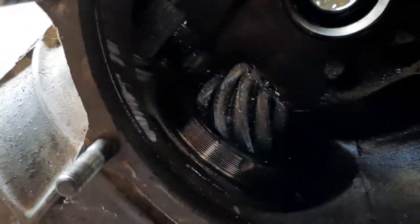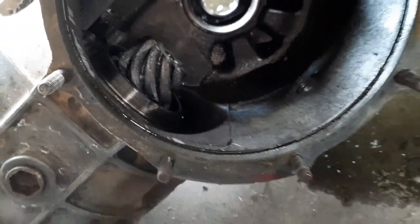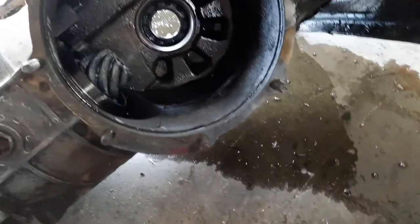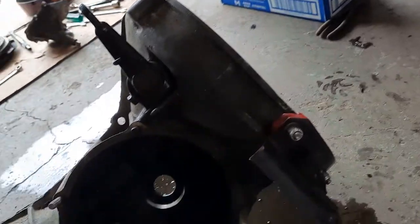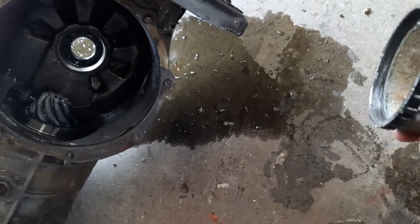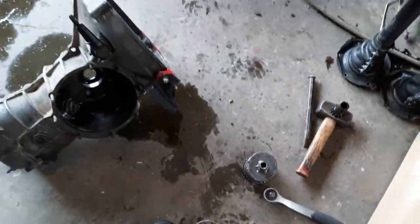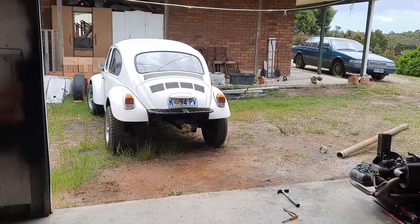Fortunately I hit the case a couple of times but not where the iron goes, so we'll get away with that - I didn't hit any sealed surface. Of course it's full of shavings now so I have to make sure I wash all that out really well. Anyway, we'll get on with fixing the synchro now - I'll pull this apart, make that other tool, and I'll do another video to show you the finished tool. Thanks for watching, hit the like please, bye.